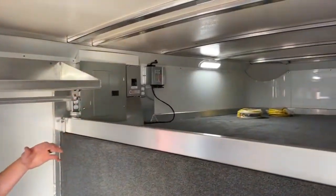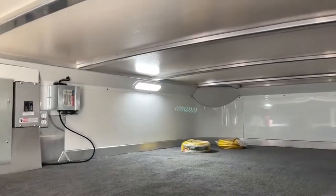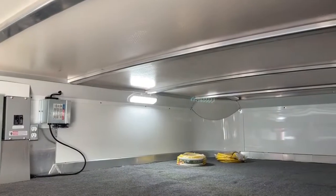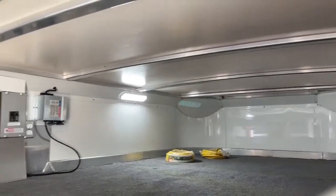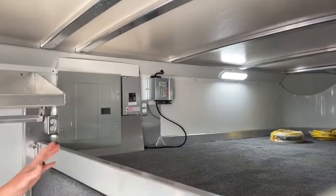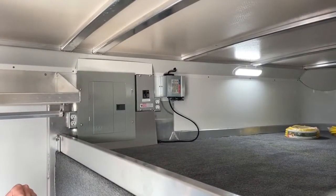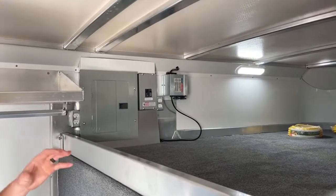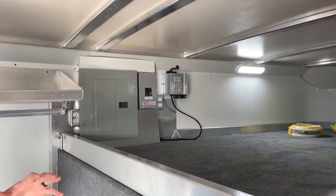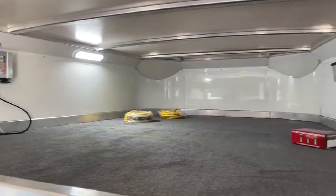As we get in here, he added a couple AC units to this and wanted power throughout it. So we went in and put a 30-amp breaker package to this trailer. That way we can run the ACs and run the outlets. He also put a 12-volt converter on here, so when you're plugged into that external power, it'll also charge the batteries up.